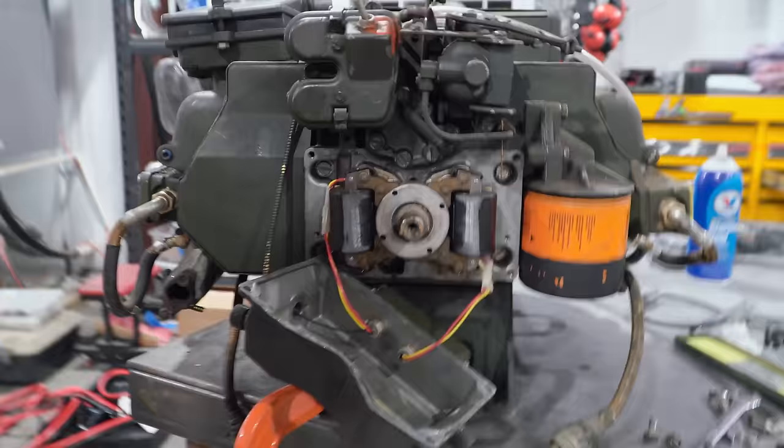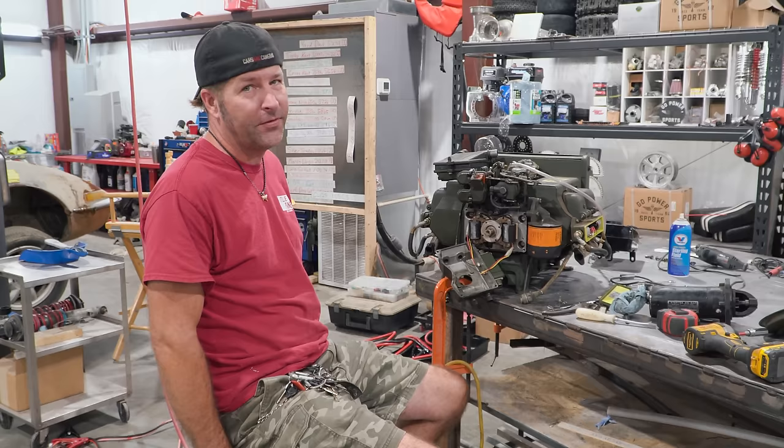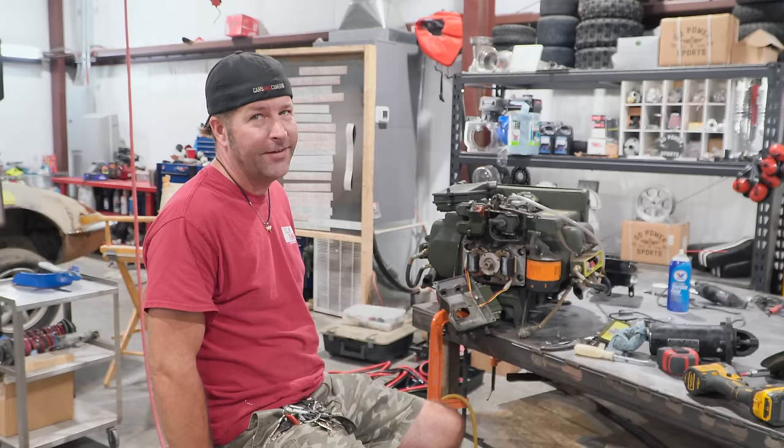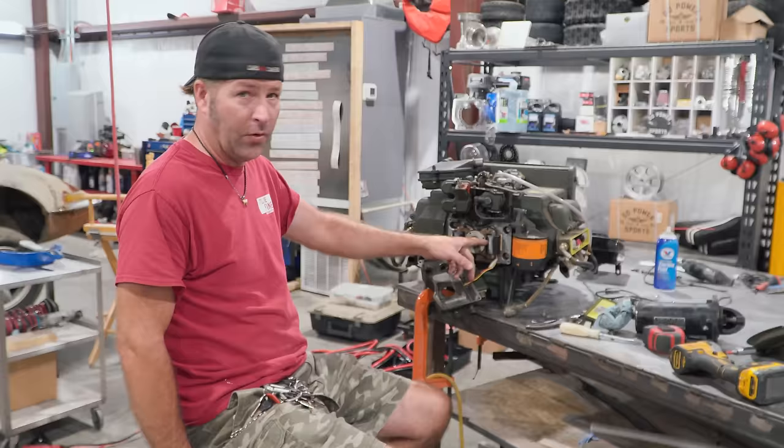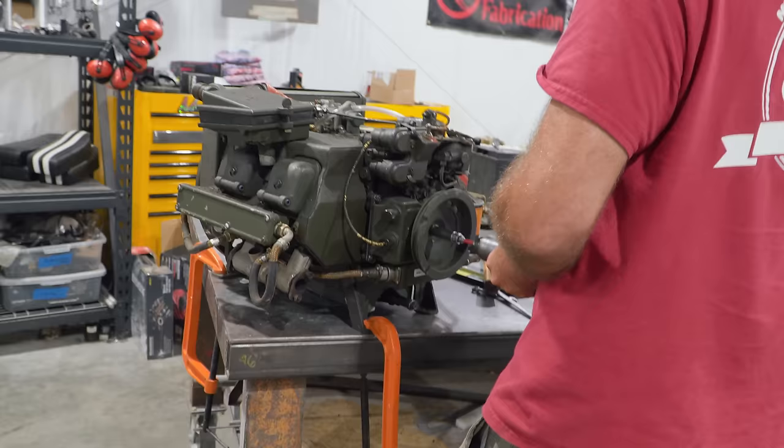That's coils. All right, so I've been going on some forums on these engines, and apparently from '06 they are a booger to start. Also, you can flip these coils over by accident if you're replacing them and install them wrong. So what I'm going to do is try to flip these coils over and try to crank it again. Here we go, crank it.